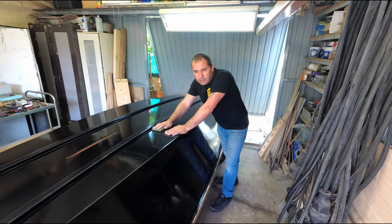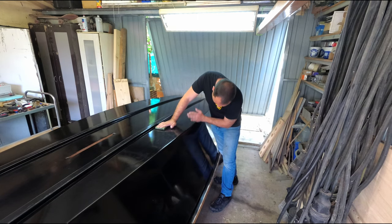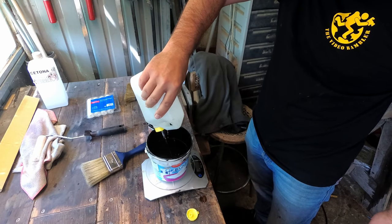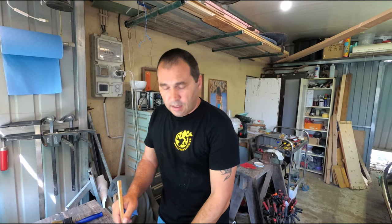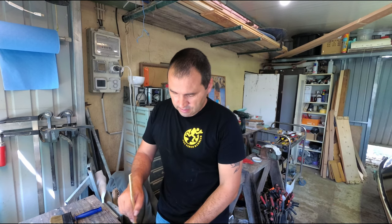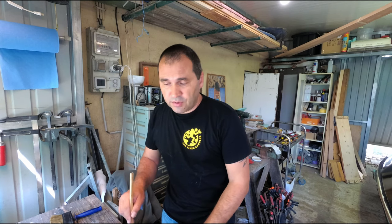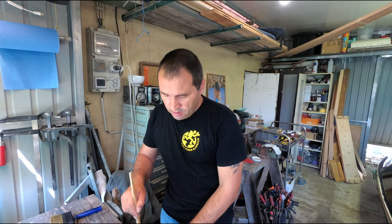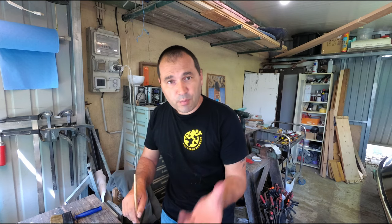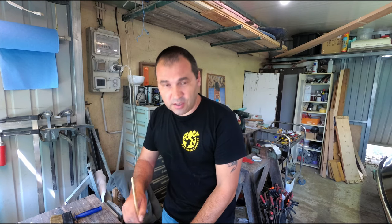On the side I'm just going to roll it again with the sponge roller — that looks awesome, well good enough anyway. As you've seen before, I usually paint the bottom in three areas. Every time I finish one area I add a cup full of thinner to the tray to compensate for evaporation of the solvent on that paint. Thanks Michael Store for that tip, it does help.